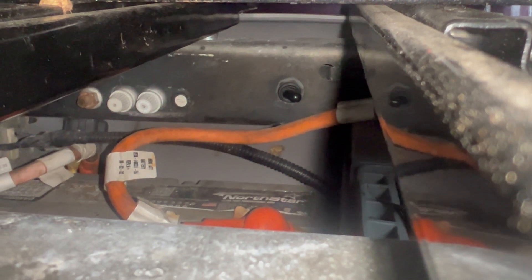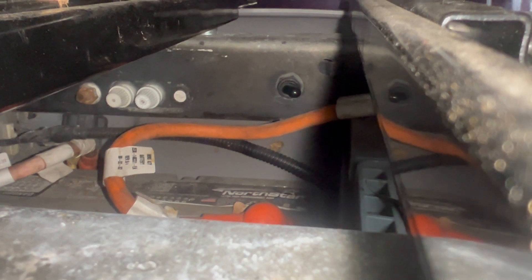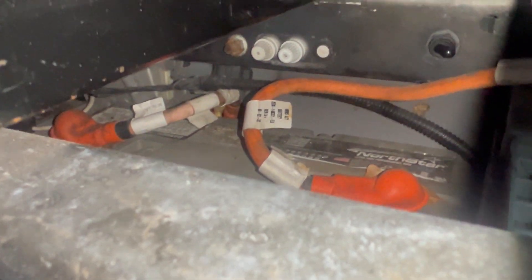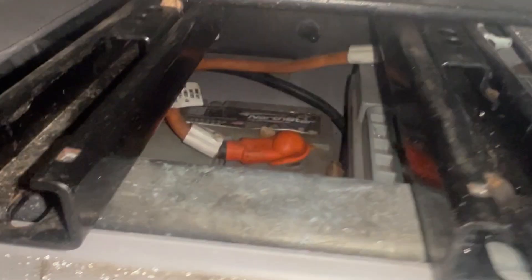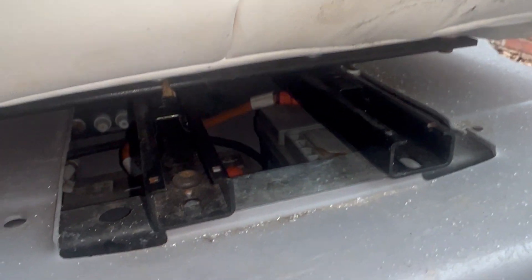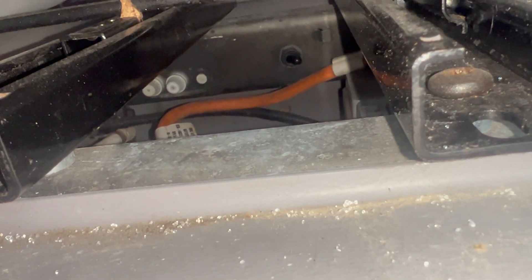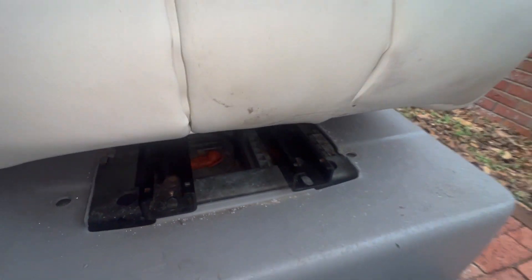The next thing you're going to want to check under your seat: depending on your cart, you'll see some fuses — the gray things — and your master switch. If you have an older cart, it will be a little further in, toward the center pillar, but you'll access it under the seat. There will be three fuses there. The only thing the cluster needs to turn on is good fuses, that little fuse you have to put a screwdriver into, the master switch being on, and your batteries showing 72 volts or higher.